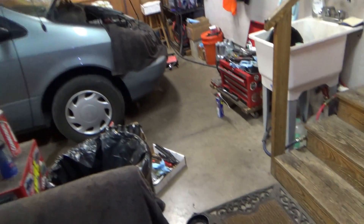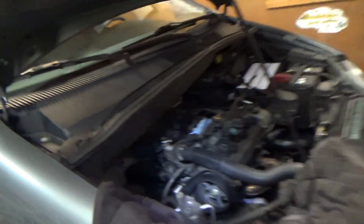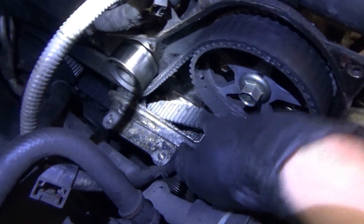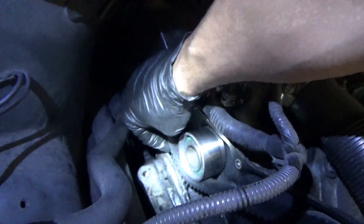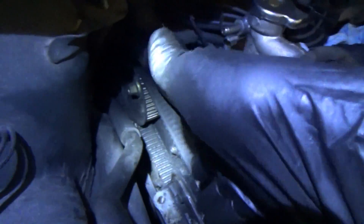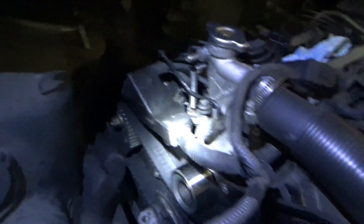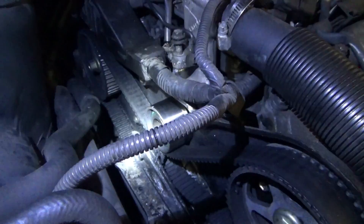A little bonus footage of the timing belt job. There is so much rubber fluff — like shaved material — on this timing cover. It's pretty ridiculous. It's a mess down there. You've got an oil leak. The belt — I'd expect it to be a little tighter. I can almost pull it off the pulley here, and there's belt material just everywhere. Something is not right. Good thing we are doing this procedure.